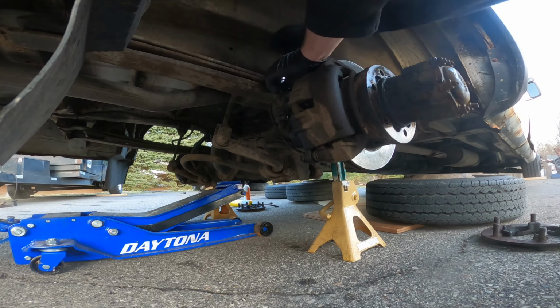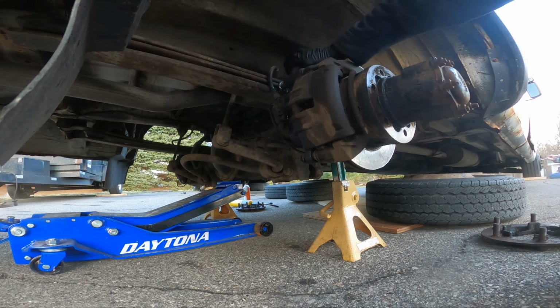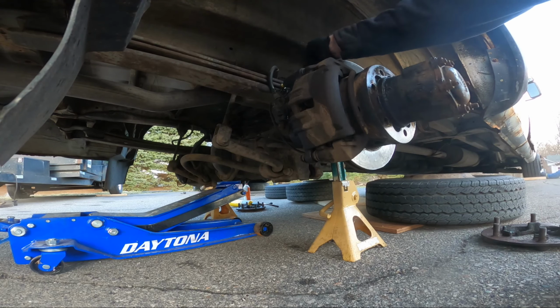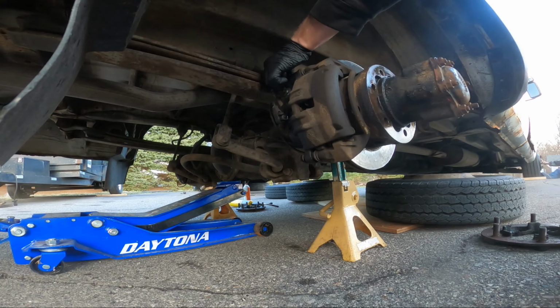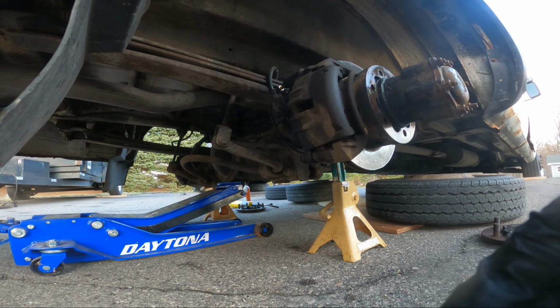No respect. These are 13 millimeter. The carrier. It would be smart to remove the brake line. Oh, it does have a rubber line. I wasn't sure. I should replace those, because that could be why that side seized if the line's collapsed. Yeah, maybe I can find those at a local shop. Does this bolt even come out with a spring in the line? It comes out enough. Alright, let me pull that line and the bottom bolt. And since I'll get new sensors, maybe I'll just cut those, but see if it comes out easy.